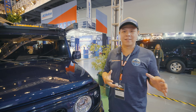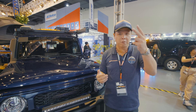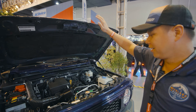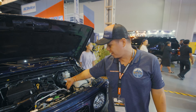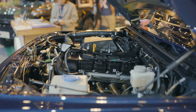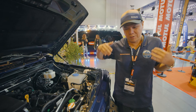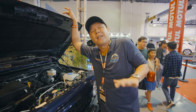Since we're going to be towing a trailer with this Jimny, we've added two main ingredients for more performance. First, this is the first Jimny — according to our friends from Constant Racing — to have a totally remappable ECU with Constant Racing headers. You can see the 2.5-inch pipe with a Magnaflow exhaust out back. That gives us roughly 30 additional horsepower, which is a lot for a Jimny — it won't give you massive performance, but it'll help you get to 80 or 100 better than normal.